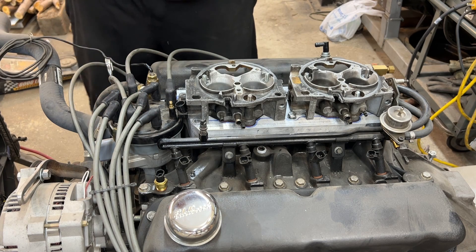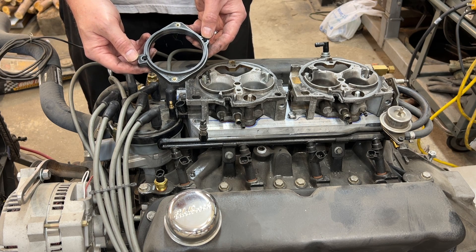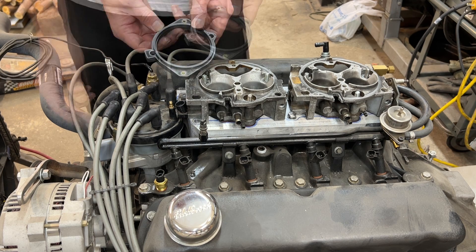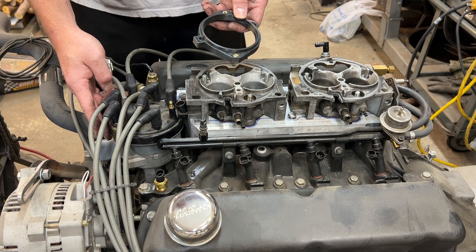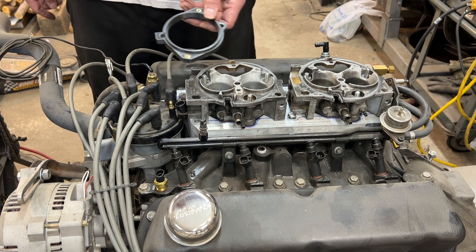The real magic is this piece of plastic made by TechMotion out of Calgary, Alberta. I ordered this online and basically what this is is an adapter that allows you to convert a TFI type distributor to an MSD type distributor cap, giving me the room that I need around this throttle position sensor.